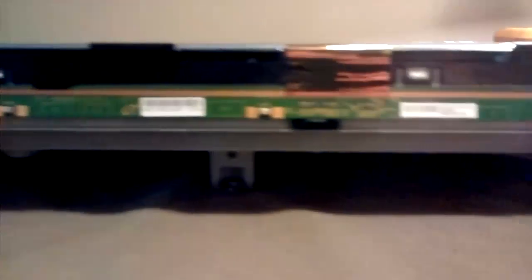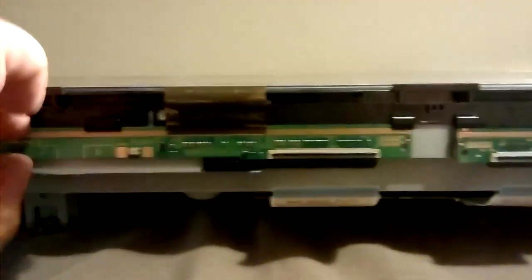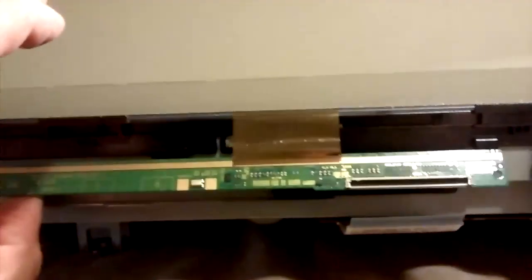So now we have to remove all the PCBs and the loudspeakers. Then after that we remove the front bezel, which is held by these little plastic clips. These bolts have to be pulled out of their plastic supports. Be very careful with these flat, shiny cables that go to the LCD glass — don't bend them too much. If they break, this can't be repaired. Now we can lift off the LCD glass, either with suction cups or just by hand.